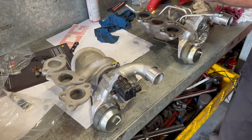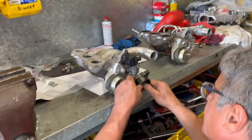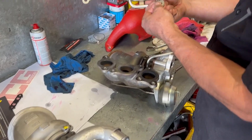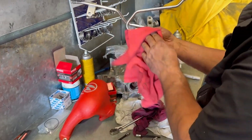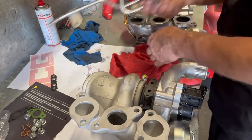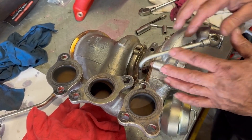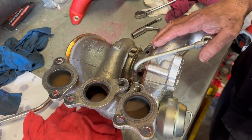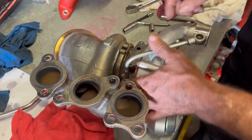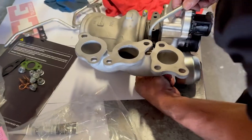So let's go over all the lines. I'll screw this back in - it's also got an O-ring on it, and it's offset so it goes that way. See these gaskets, they're really good gaskets. In this case because it's so clean I'm going to get it in the right spot so I don't have to undo it. The critical part is because they're solid - if it's a little bit out we can always loosen it, but I'm trying to get the exact same position. I'll measure that - from there to there, 11 mil, 7.4 - that's the oil feed.